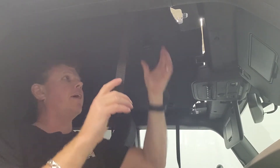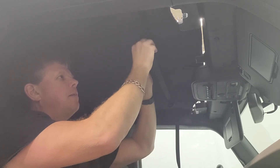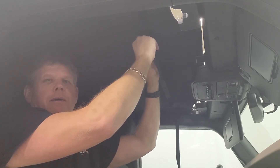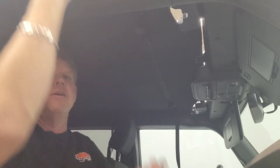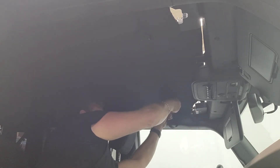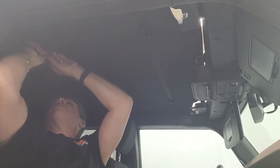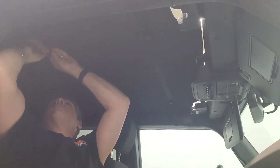Now we're inside the vehicle. Your straps are all hanging here and they line up with these ladder locks — they go through the same way. I would not tighten them fully yet. Make sure they're centered, because if you pull one side too tight your magnetic strip on the outside won't be centered. Snug them up on both sides equally. You can look from inside to see if you're lined up properly. Once in place, go do the one directly over your head on both sides, and the one in the back.